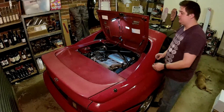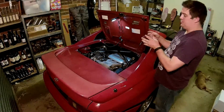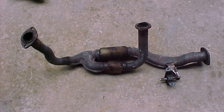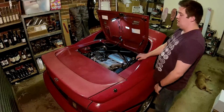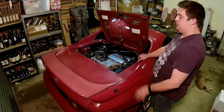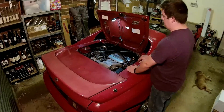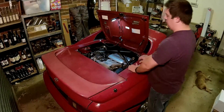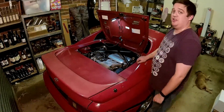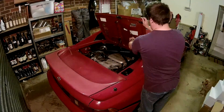The exhaust on this setup is just the standard Camry Y-pipe underneath that joins the two cylinder banks together — and it's very restrictive. One bank comes into the other pretty much facing the wrong direction and has to make a 180-degree turn to go toward the back of the car. In this case it's all married up to the standard CAT and the standard non-turbo muffler. Interestingly, the unsecured air filter is allowing a much better induction noise — this one actually sounds magnificent. Well, that's it for this episode — I hope you've enjoyed seeing a bit more about the V6 conversion. I'll see you next time on The Dandism Project.